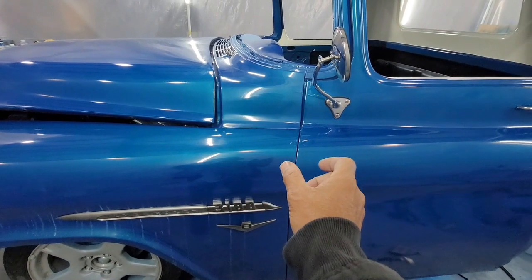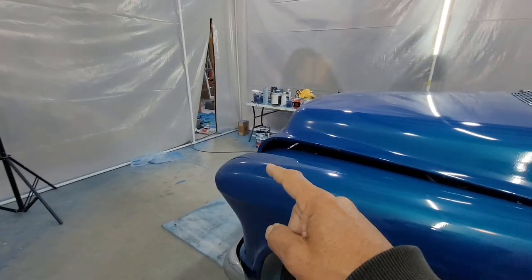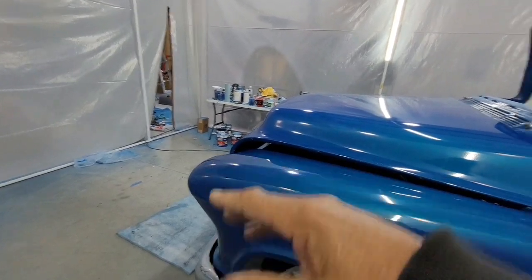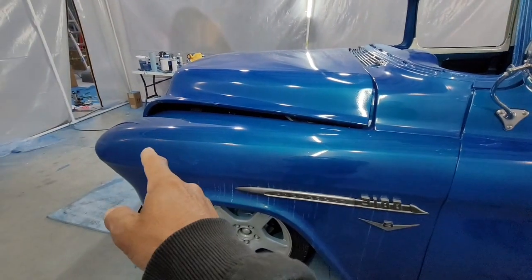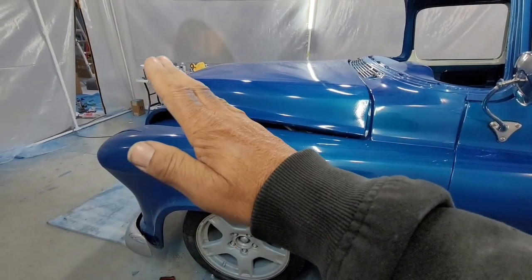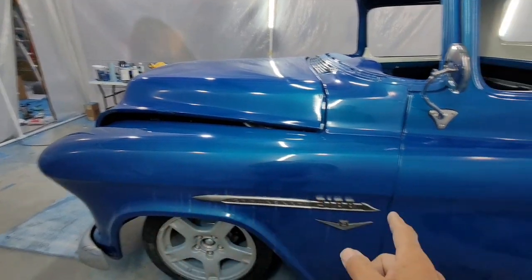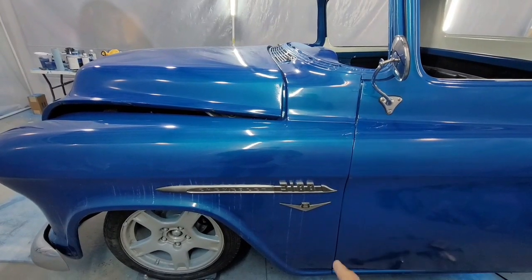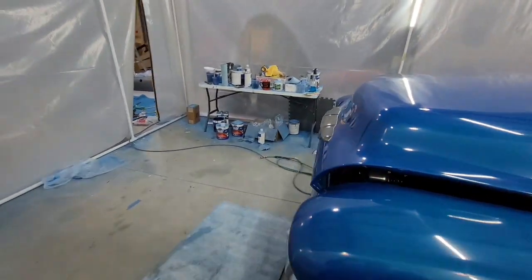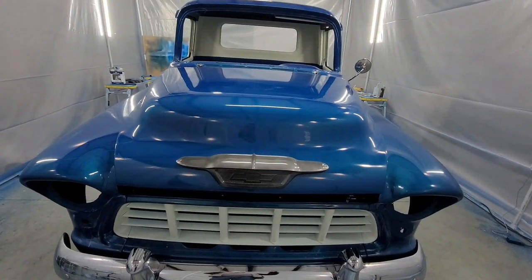If the gap is too close on the bottom, too far away in the top, that means the nose and where your radiator support is too low. You can shim it up. You just shim it into these two gaps. Because remember, your radiator support adjusts this gap by lifting the nose up and down. And you're not going to 2 feet up and down, you know, a fraction of an inch up and down will make a big difference on this gap. So once you get the radiator shimmed and this gap's good, do it on both sides. You get the orientation to those gaps to the doors.